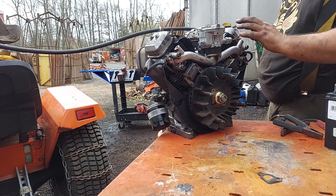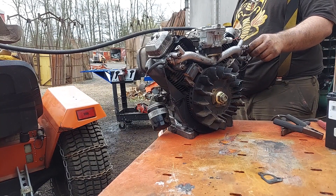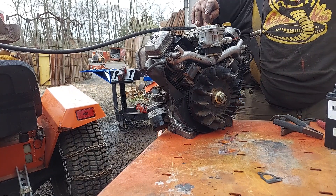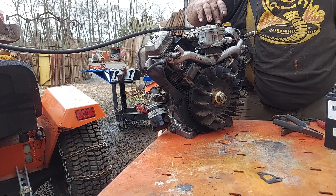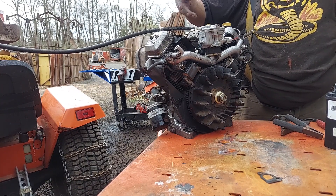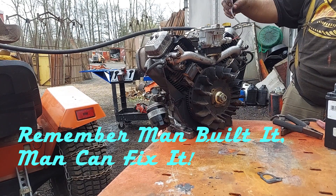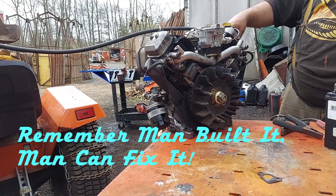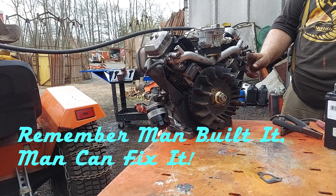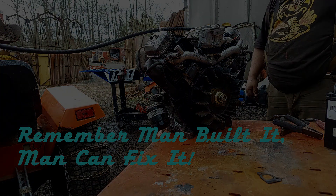Install your cover — you got your bolts, your fuel pump, all that. If you need to be reminded how to do that, that'll be in the take-the-engine-on-and-off video. Here should be all set. Put your gasket — make sure you get your gasket here with your air intake and air cleaner. Put that on, fold it all together. Your fuel line routed out of the way with a good filter on it. Make sure you hook this up to your power in the harness, hook your ground wires up here for your coil from the key switch. Thanks for watching.